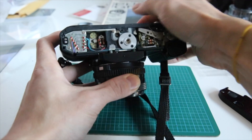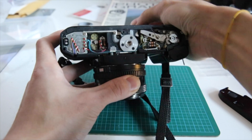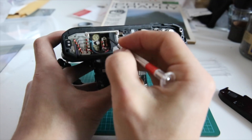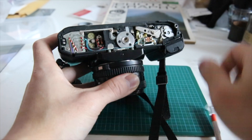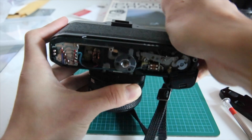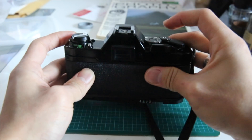You can take a small screwdriver and try it. If your shutter does not move — everything is stuck and pressing the button as many times as you want won't trigger it — if you press that pyramid piece upward it should go off. After that, hopefully in your case, you should be able to wind and take photos with the AL-1 as you see fit.